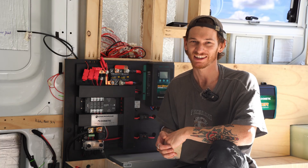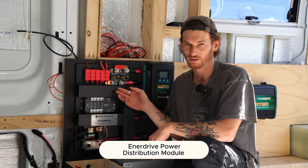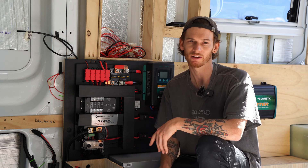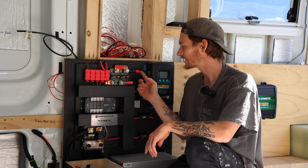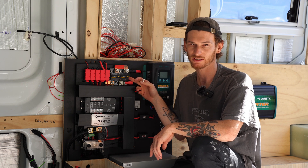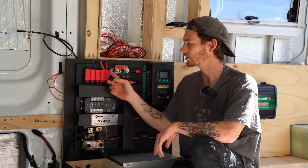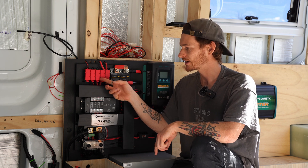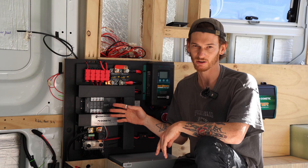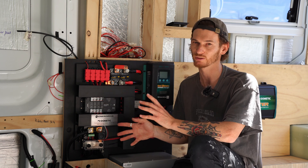Now we've put together our whole electrical system — here's a rundown of everything. This is our power distribution module, which allows you to buy inverters, chargers and batteries separately so you can customise your layout. Power comes in here to the positive bus bar. There's a 250 amp circuit breaker to protect your inverter, then a 200 amp circuit breaker covering the whole distribution board. Up here the positive bus bar goes into midi fuse holders which protect your loads that run through the shunt. There are two shunts which work with the Simarine battery monitor system. Down here is the negative bus bar — all your connections come to this one central location.